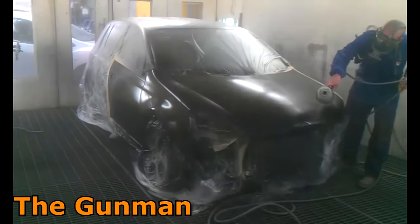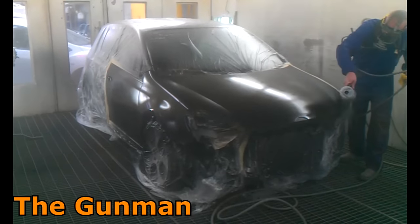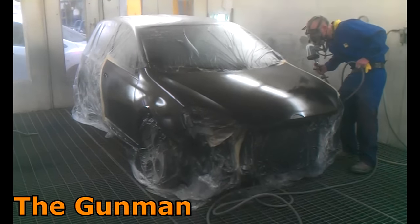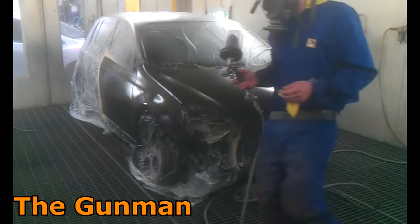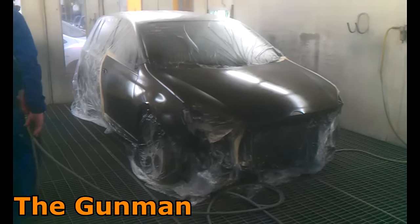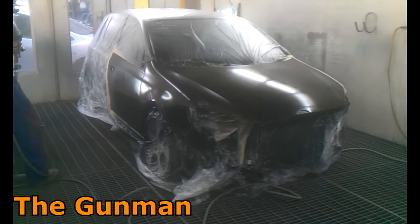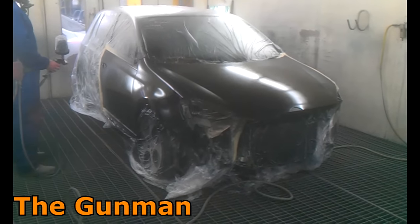This is around the time when I did start doing the dry sanding techniques and also first using HS clears correctly with HVLP air caps. It took me a little bit to get the hang of it at the start — about two weeks — until the reps actually came out and showed me how to use the HVLP air caps properly with their HS clear.